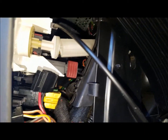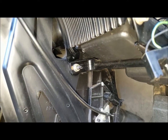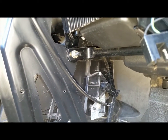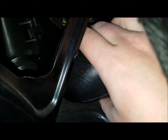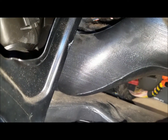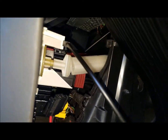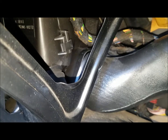The other reason why this thing breaks is that these drums, as they get old, tend to stick, the drum itself sticking to the outer wall of the casing, and it makes it pretty tough to spin. So sometimes you can pull this off and spray some lubricant in there, or I've also seen some ideas where people try to separate the outer wall of the drum casing just a little bit so it doesn't stick. But it's something to be very aware of, because if you keep breaking these control shafts, then you may want to take a look at what's going on inside the drum behind it.